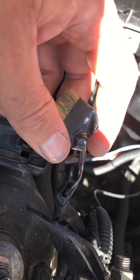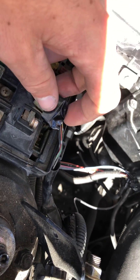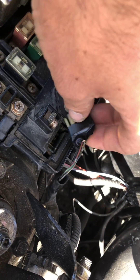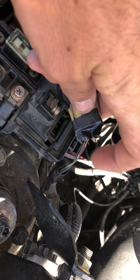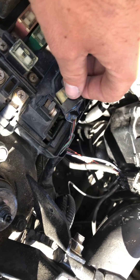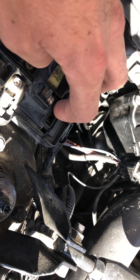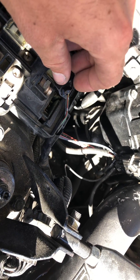That black and yellow wire is from the ignition switch and you will blow a fuse. To bypass the Electronic Load Detector, that's all you need — just an 820 ohm resistor, put it on the red-green wire and the black wire. That will trick the ECU into always seeing a 5-volt signal, so it will keep the alternator running constant — it'll never shut off and come back on, it will always be on, like every normal vehicle.